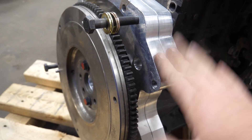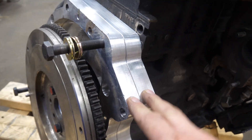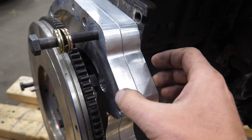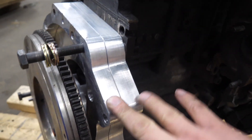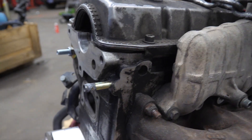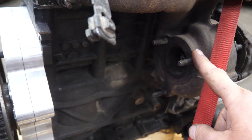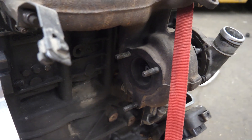Starting with the adapter plate, we ended up making a two-piece design. The IFS trucks use part number 2254, which is the same thickness as part A on the 85 and earlier straight axle trucks. I added a spacer to move everything forward, partly for the vacuum pump, and also to buy a bit more space with the turbo — it is really close to the starter, and this moves the back of the starter away from the exhaust housing on the turbo.